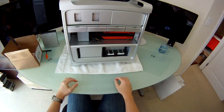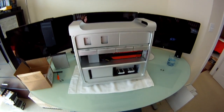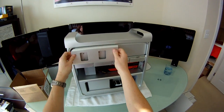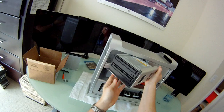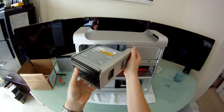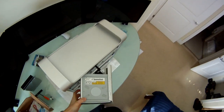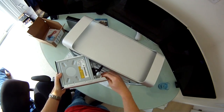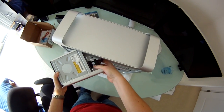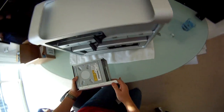Now, the module we'll be removing is this one here, which is the optical drives module. It's not exactly the easiest module in the world to use — it requires a bit of brute force to pull it out. But inside you'll see two Super Drives. I disconnected these black cables, which are the power and the Serial ATA cable — we'll just pop those off, one for each drive. Then the whole module can be removed.